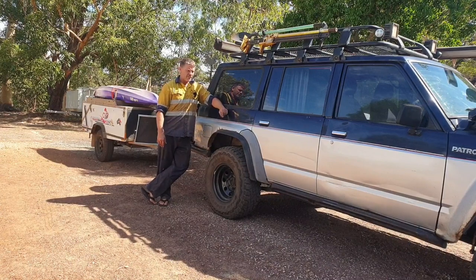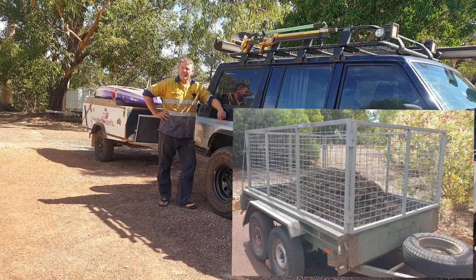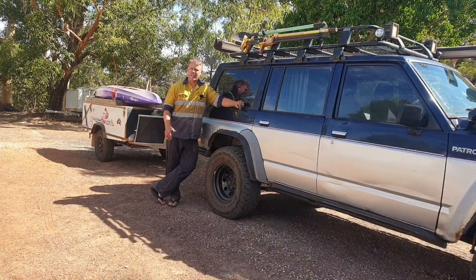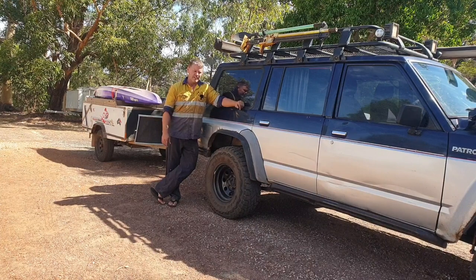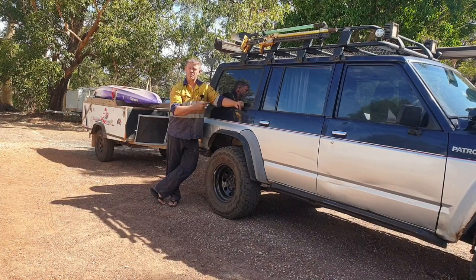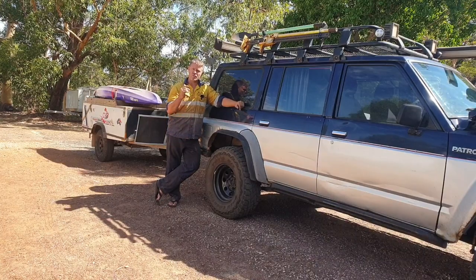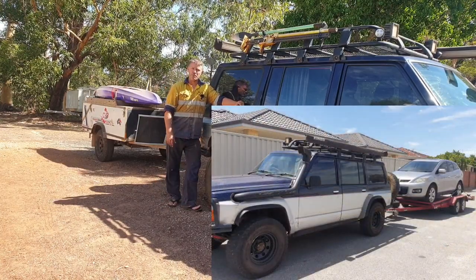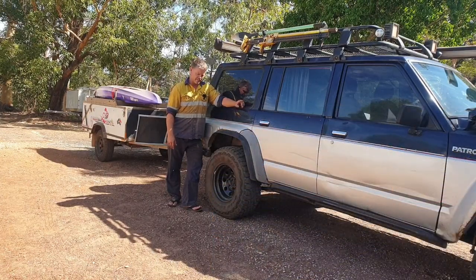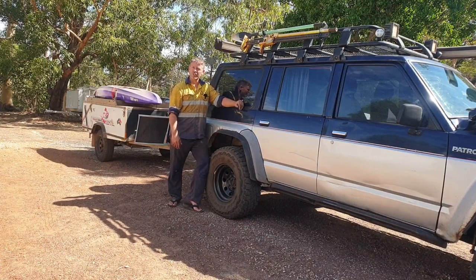I also forgot to mention long-range fuel tank, lift kit, bigger wheels. Done a couple of runs this morning - went and picked up a trailer load of mulch. Coming back up the hill roughly doing 80 kilometres an hour, got exhaust temps of 300 and engine cooling temps of about 85. I'm using a Red Arc coolant temp gauge so they're pretty reliable. Then I did a run picking up the wife's car, towing it on a car trailer.